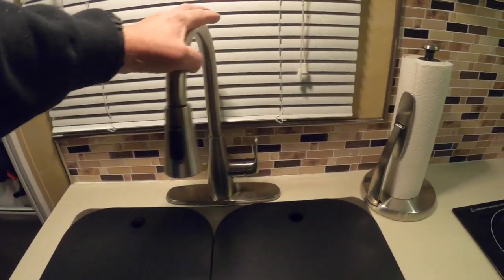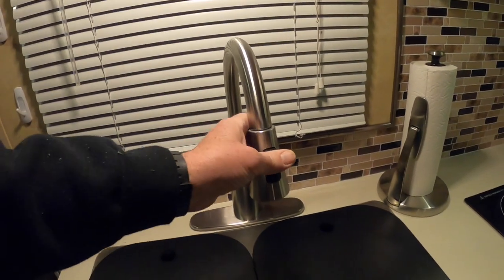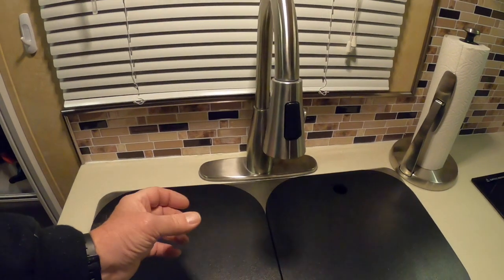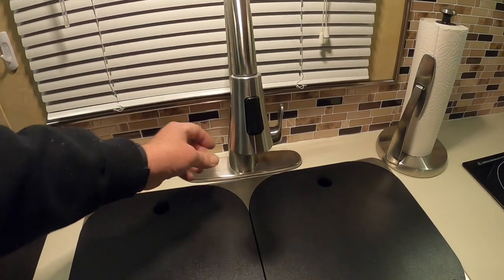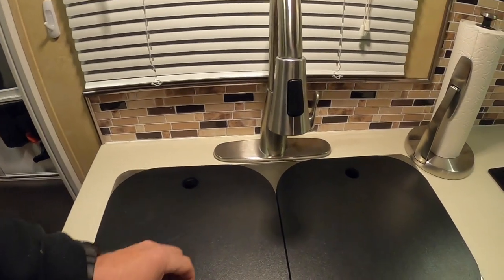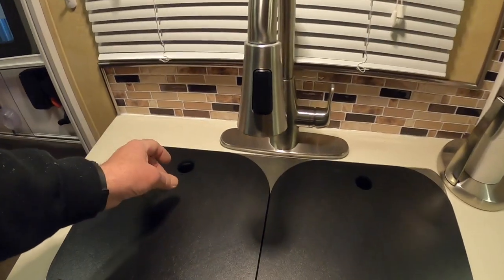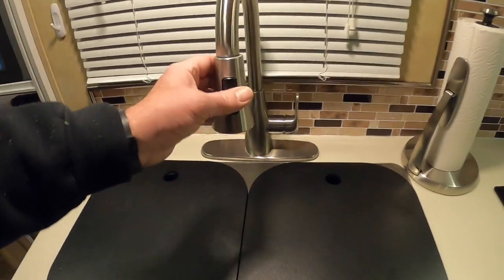And you see I got a nice residential type spigot here. I'll put that in. I believe it's Hampton Bay. And it pulls down, which is really cool. The thing to note, though, the RV fittings on the end of the PEX, they're usually 1/2 inch. Yours might differ. Check it out. But the residential type hose requires a 3/8 inch flare to go into. So I'll put the link in the description of a 1/2 inch pipe thread to a 3/8 inch flare. Just little adapters. They're not much, but you will need them. Put them on top of the PEX and then screw the flexible hose right onto the top of that. And then you're good to go.